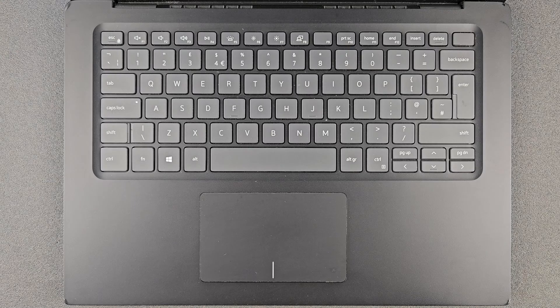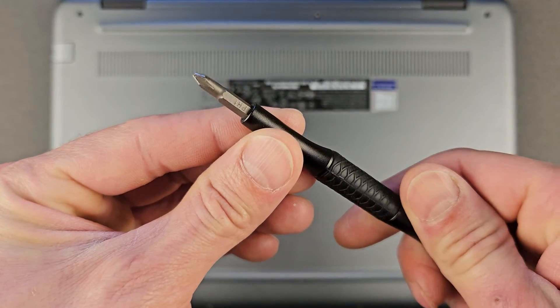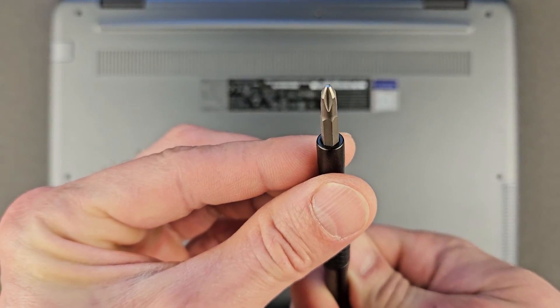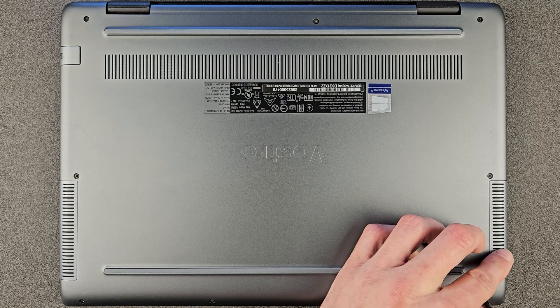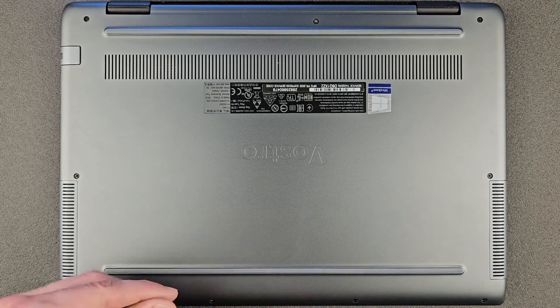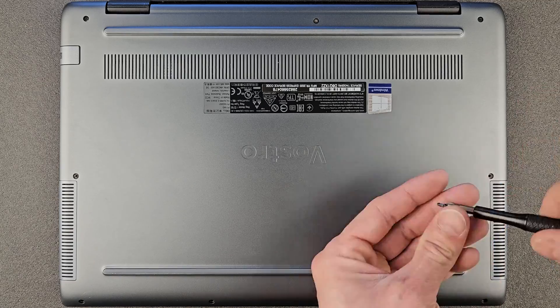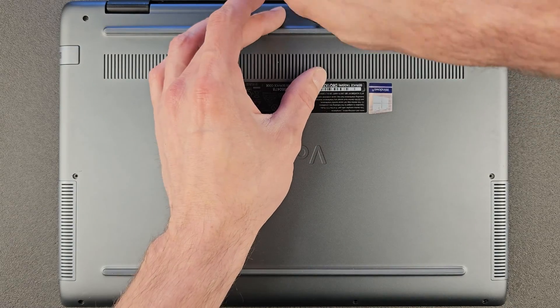We're gonna see how you can open up this little laptop as well. You need a pretty standard Phillips screwdriver and you have to remove all the screws on the back panel. I'm using a 57-in-one — it's a great tool for other little jobs as well, not expensive. Now the screws on the back panel are different lengths, so keep them separate so you remember where you took them out and know where to put them back.